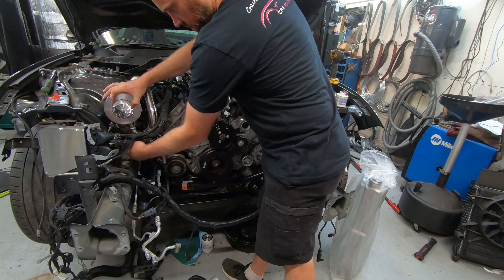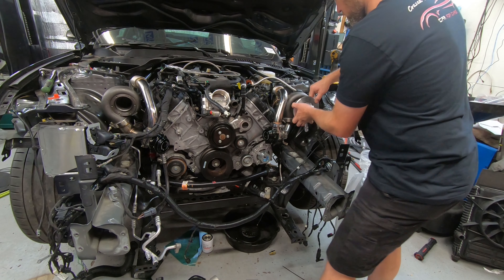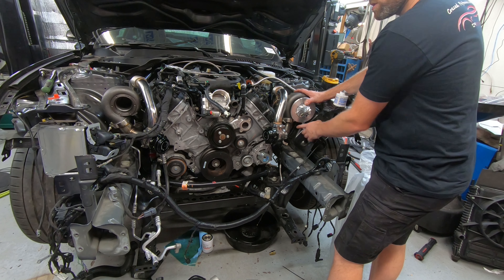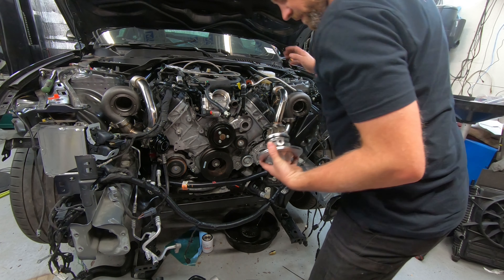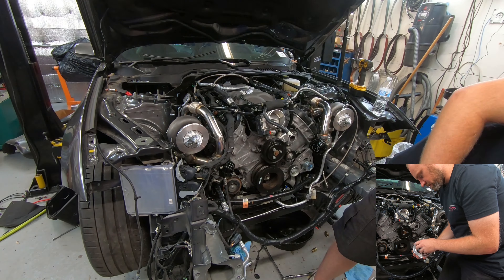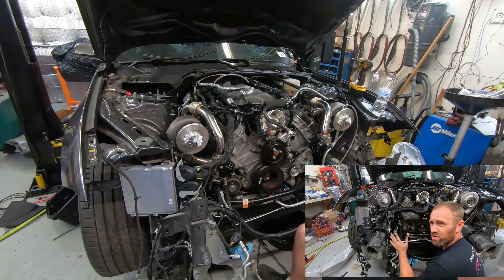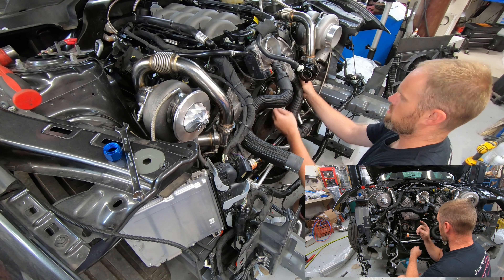Unless I have to flip it around — so I'm going to flip this thing and see how it fits on either side. If I have it on this side, it's straight up and down but it's going to hit the wastegate pipe. If I put it over on the other side, straight up and down, it's going to hit this part of the fender well area. So no matter what side I put it on when flipped, it doesn't work. This fitting is just not set up well for this car. I'm going to have to find a different fitting — more like the straight fitting on the other cartridge. I cannot use that other one.